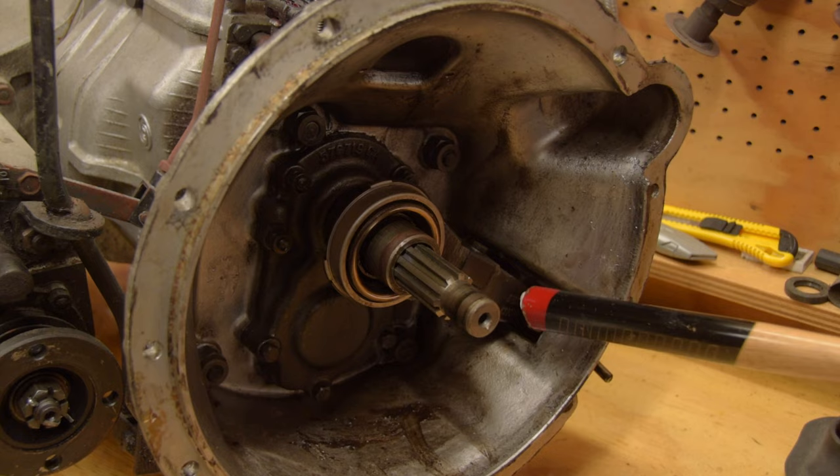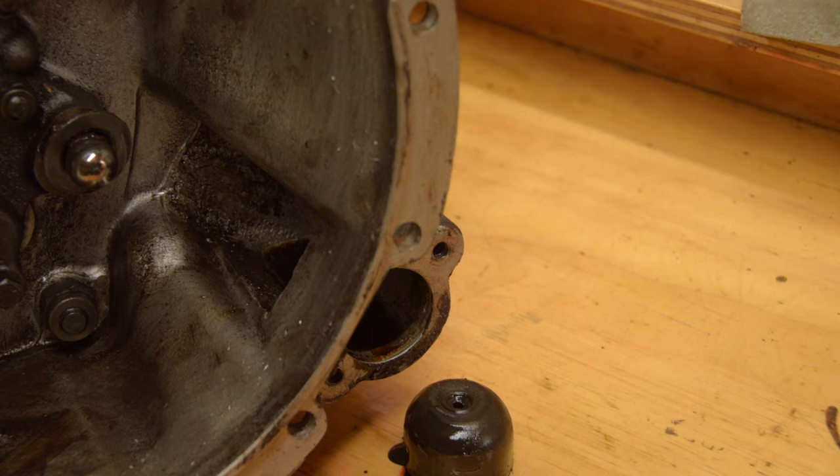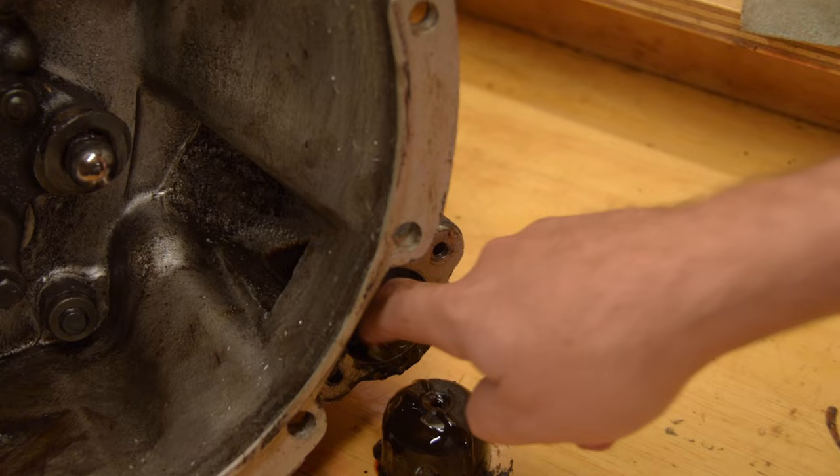This is the primary pinion, the part that the motor turns and the clutch slides on. Clutches don't like oil. Luckily I think it's just hydraulic fluid from the broken clutch slave cylinder — we'll be replacing that anyway. If it was oil from the back of the engine, that would be annoying, but I think we're safe.